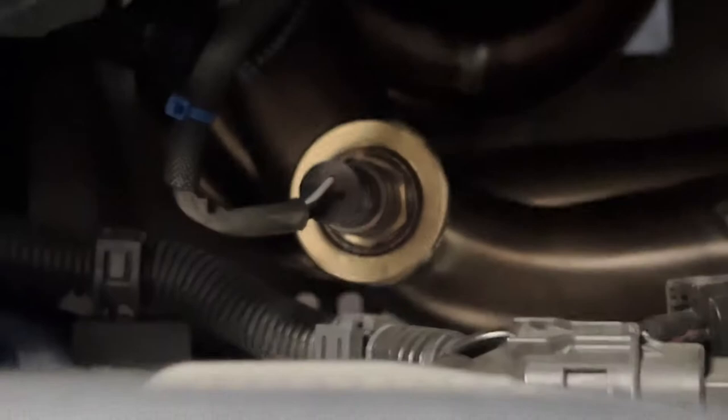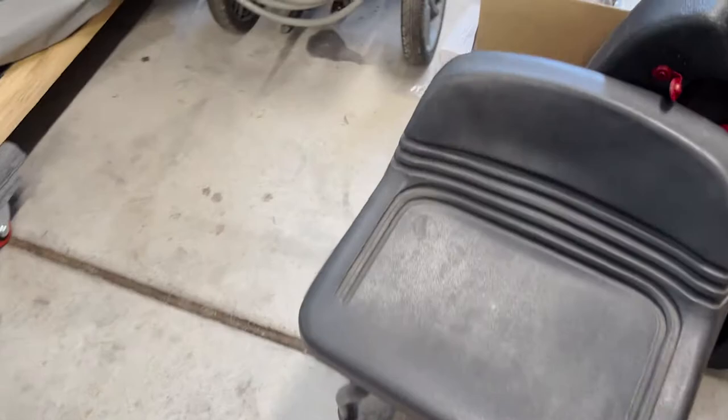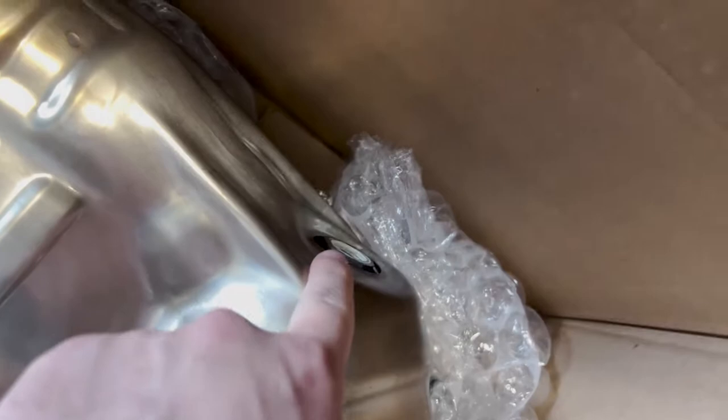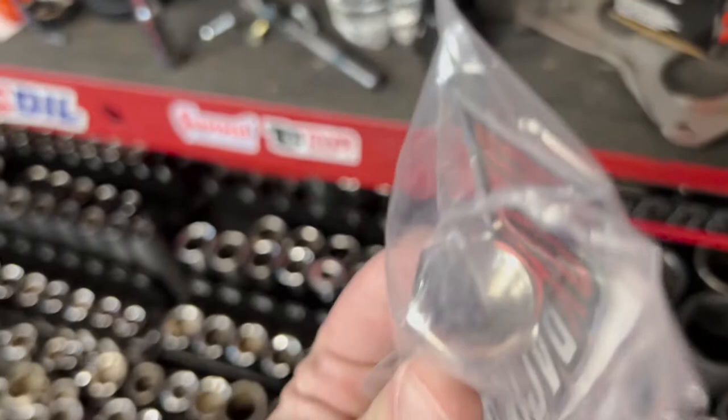So it's a pretty simple fix. It's not that O2 sensor, it's the one down there tucked behind the headers — the one that goes after the cat. It's not this O2 sensor before the cat, it's the one right there, right next to where it connects to the overpipe. So all you really need is a defouler, which is basically a spacer that goes in between your O2 sensor and the headers. It gives it a very restricted amount of air, which basically tricks the O2 sensor into thinking that it's reading accurately — it's basically thinking the exhaust is cleaner. The smart move is to get this before even putting on headers.